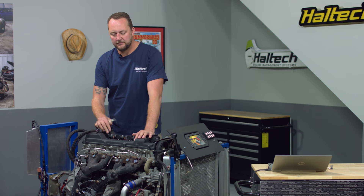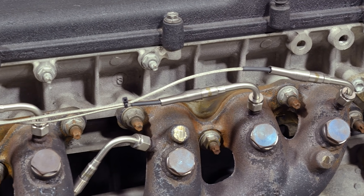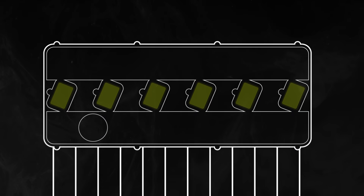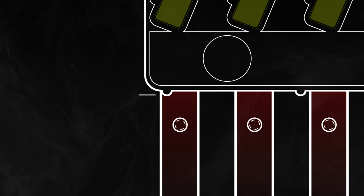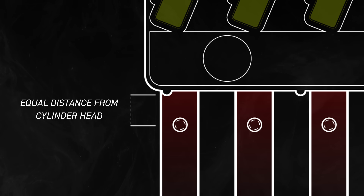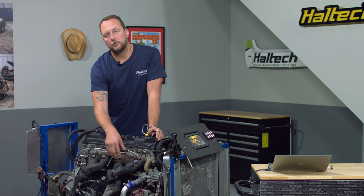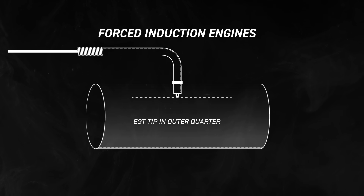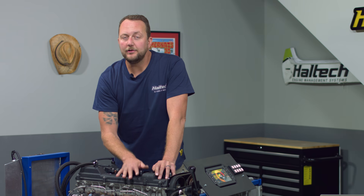Here's our test 2JZ engine. Along the front, it's a naturally aspirated engine — we've got six exhaust ports for the six-cylinder engine, and up here we've got six EGTs fitted. The first thing to note is that the EGTs are all mounted a certain distance away from the cylinder head — it doesn't really matter what that distance is, just as long as they're all equal so that the sensors all get an equal flow. The second important thing is that those probes are all mounted down into the runner at the same depth. If it's an aspirated engine like this, we're looking at having the tip of the sensor probe sitting right in the middle of the exhaust. If it was a supercharged, turbocharged, or nitrous engine, we'd be looking at having that probe tip at the outer quarter of that exhaust runner — quite important for getting good, consistent temperature readings.